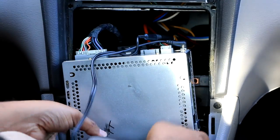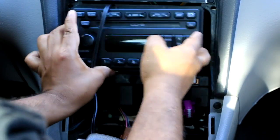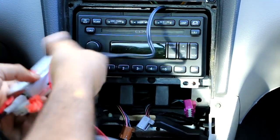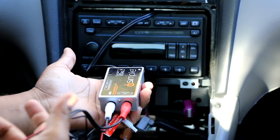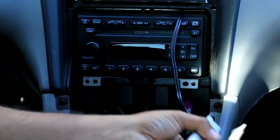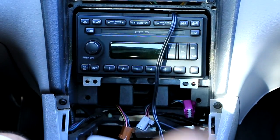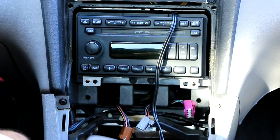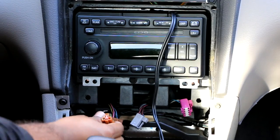That's it. Then you're going to put the radio back in, but I'm going to test it out first — I just want to see how the sound is. For power, you've got two or three options to get power to the i-Simple unit. You can get power from your radio head unit, from your fuse box, or from your cigarette lighter right here at the bottom.